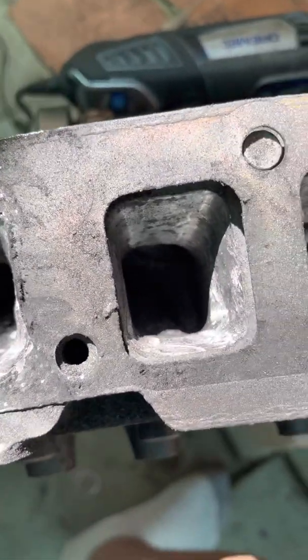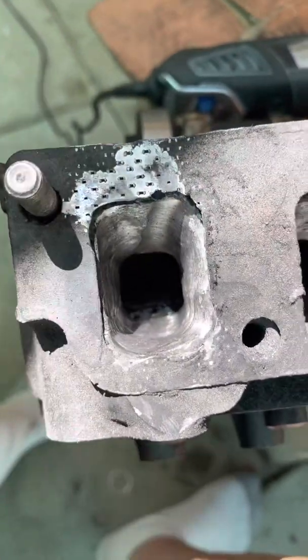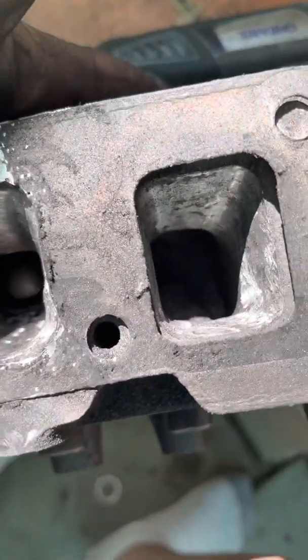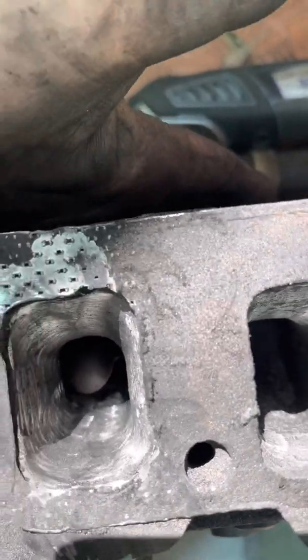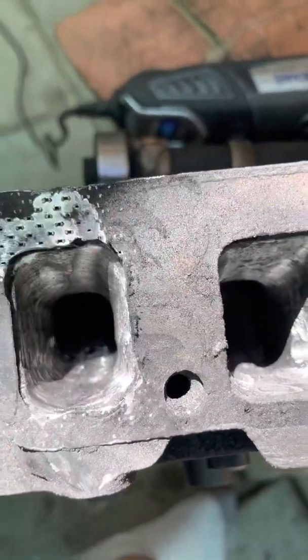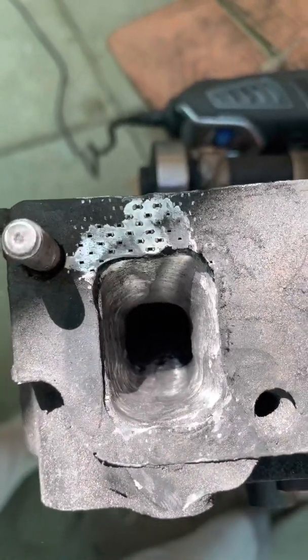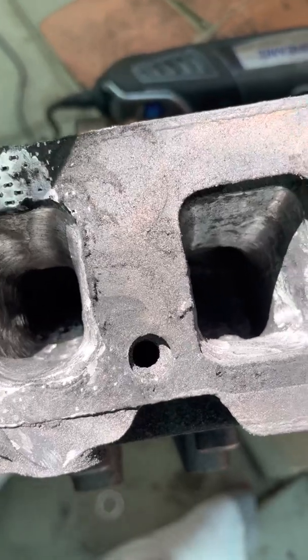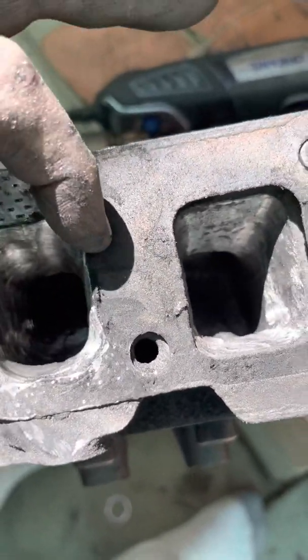The idea is to not have the engine push it out, to have it just run out. Just pop it. So when the valve opens, here's my finger going through the valve seat area. There's a lot of energy left in it. If you have a muffler leak or exhaust leak, you know how loud it gets, how loud motorcycles are, because the exhaust still has a lot of energy left in it. So this is sort of a draft tube.